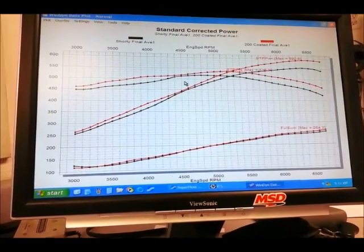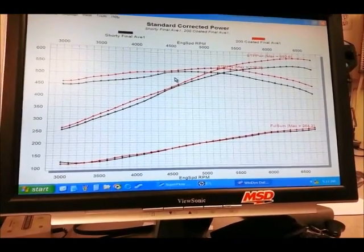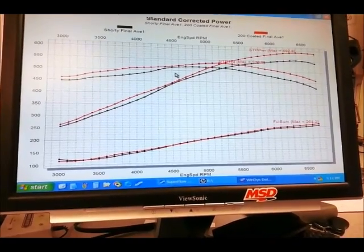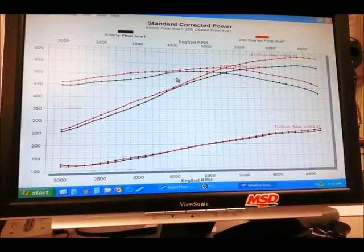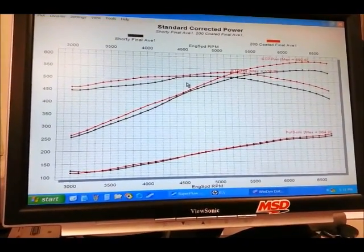Now, the thing we want to point out to people here is that this is kind of a comparison of best case scenario. You pick the perfect header for the engine, the header fits in the car, everything's hunky-dory, versus, hey, I can't put anything in except for either a stock manifold or a shorty header. That's really the kind of compromise, the trade-off that we're dealing with here. The shorty's not going to be your best choice or your first choice if all-out power is what you're after. But if you're looking for fit, you want to do away with a lot of the hassle of getting a set of headers up under your car, the shorty is just a nice way to go.